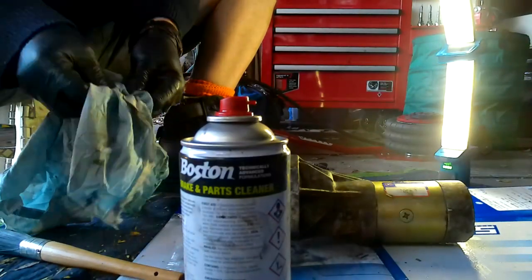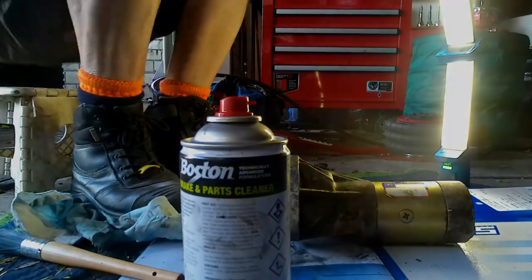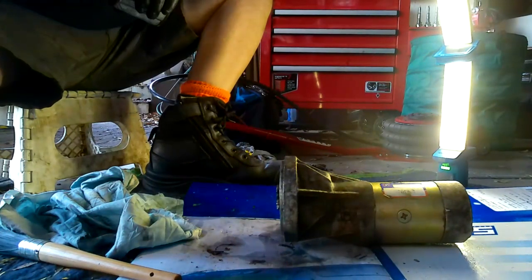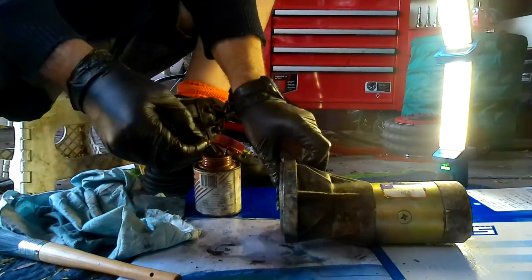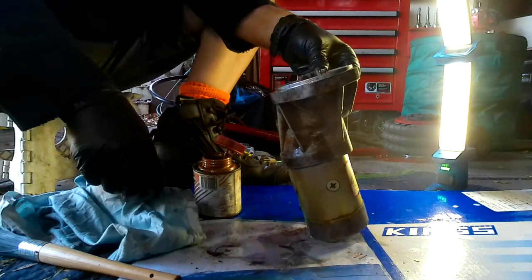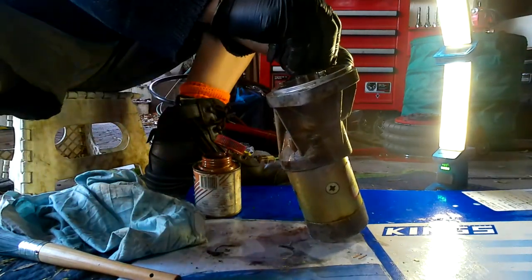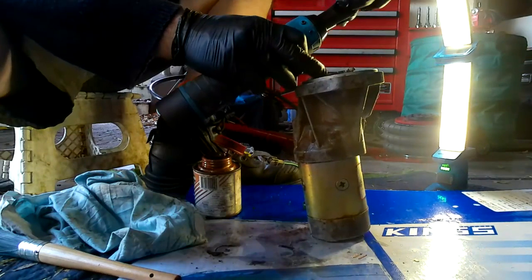These screws are wiped down, put some grease on them, put them back in. Probably put a bit of copper coat on them. That's probably the best thing to do. Now, there's two schools of thought with this stuff. One is, don't put it on because it increases your torque settings when you torque things down. It makes them spurious. Personally, I don't agree with that. It might do that, but I don't care. I'm more interested in getting them out next time I go in there. So it irritates the hell out of me when I see people not putting anything on them at all and just sticking them back in dry. But for my mind, I want to know I can get them out again. So I'm putting copper coat on regardless.